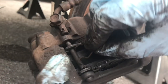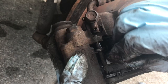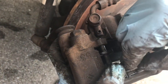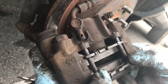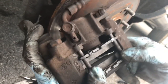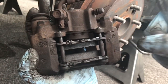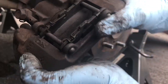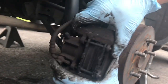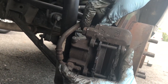Then this is the last one. You see there are holes — a hole there, a hole there. You might have to use pliers to make sure the holes line up. You can turn the rods, just kind of pull it and press it down into place. Ideally, before you put the pads on, get some brake pad grease and put it around the back of these pads — that way they won't squeal when you brake. I've found that even without the grease they don't squeal on me, but you want to do that.